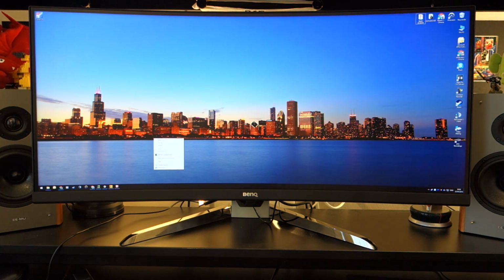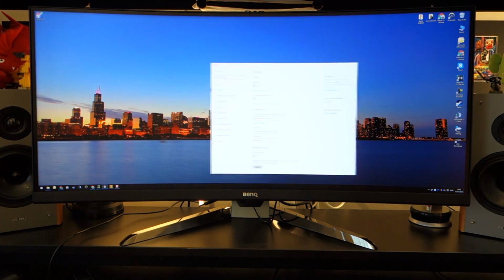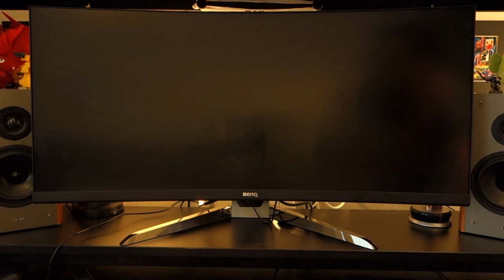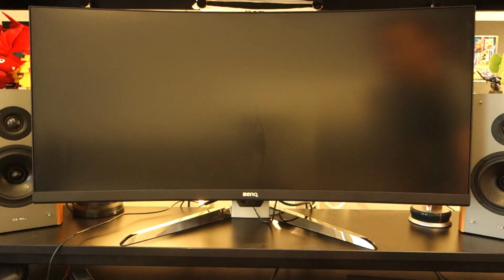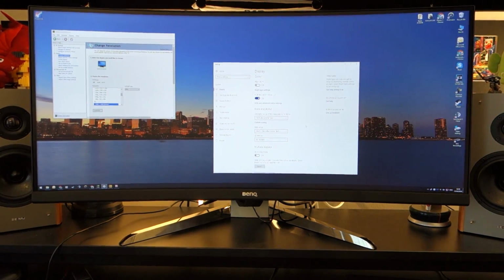How does HDR work? Now, the implementation over Windows is a little bit hit and miss. So first of all, at least I've got the NVIDIA GTX 1080, you want to go onto NVIDIA's control panel, set it to one of the default resolutions, not a custom resolution, so 60 Hertz. And then you will have the option to enable HDR. As I said, I've got it on HDMI, but you can work it on DisplayPort as well. And if you saw on the bottom right hand side, got a little notification saying, hey, your HDR is on.